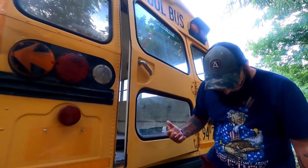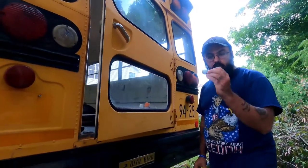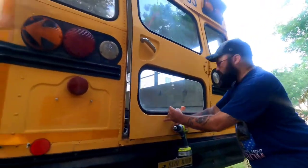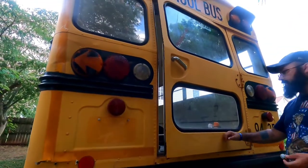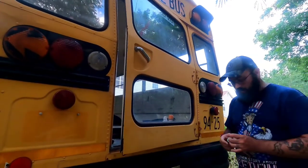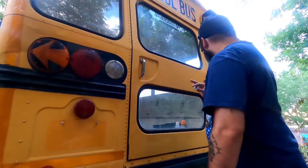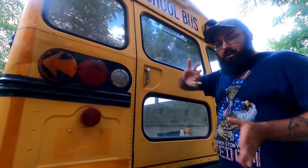The problem is I've still got to replace some actual light bulbs because they're just blown. This one looks pretty old — kind of cool actually, cool colors. Anyway, that one came out, and I was able to take one of the stop sign lights and put it in there. It works but it's very dim and takes a minute to turn on — I think because it was a flasher bulb. But at least we know the connection works. We're just going to get the right bulb. Now I'm going to run up and hit the brakes to make sure all four work, then move on to the next set of lights.